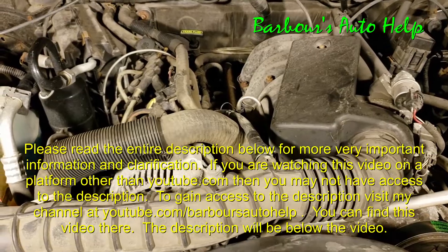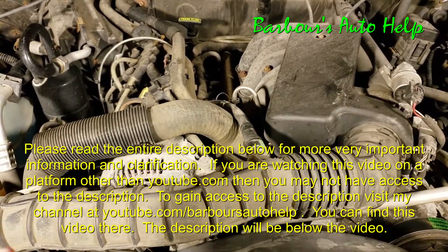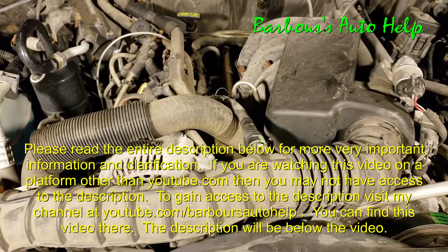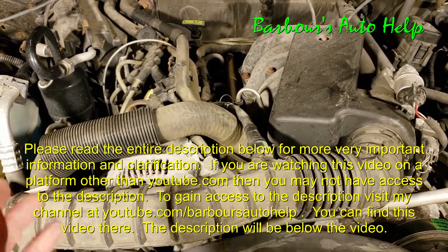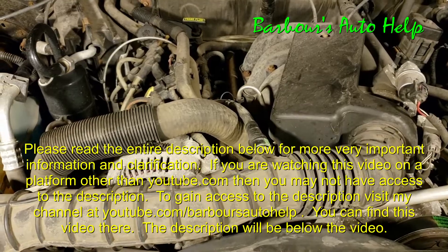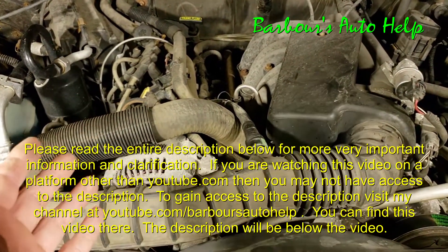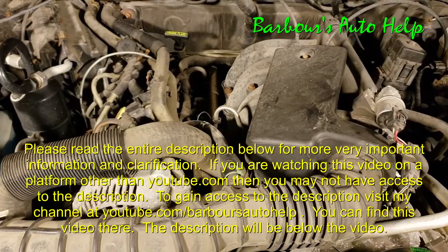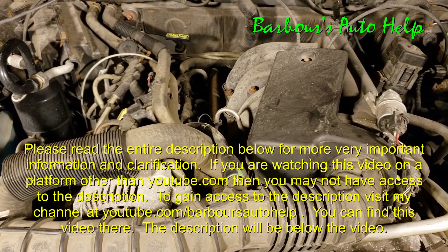If they don't know what they did wrong, they need to check themselves — that's good for that. Also, if you get cylinder misfire codes like P0301, 302, 304, on up to six, you know which cylinders you need to look at. Each of those P0300 codes corresponds to a particular cylinder: 301 is number one, 302 is number two, so on and so forth. Cylinder identification is very important and very useful when it comes to working on vehicles.